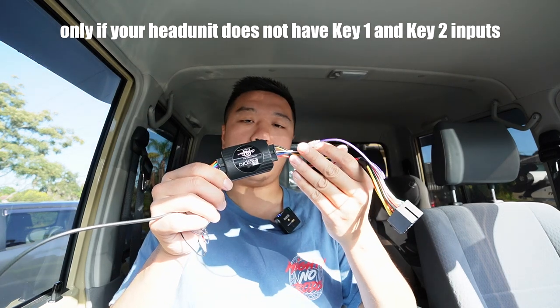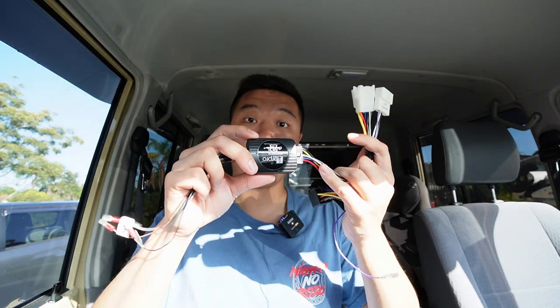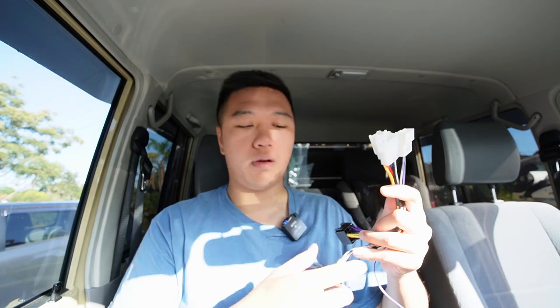If you don't have an Android unit — you might have something like a Sony, Pioneer, or Alpine — you will need something additional to the steering wheel control harness. The harness I made is going to be the exact same: you still have those three key wires and the illumination. But you will need to run it through a decoder. It's not as complicated as you're thinking — you don't actually need to use the whole harness. You just need to run the three wires — key one, key two, key ground — through this decoder, and the illumination just goes wherever you can find 12-volt illumination. I'll include more information in the description.